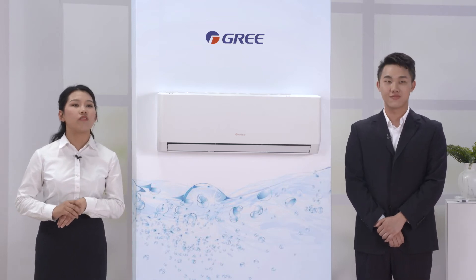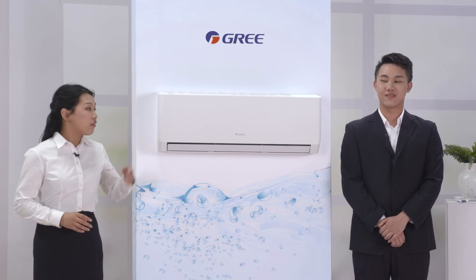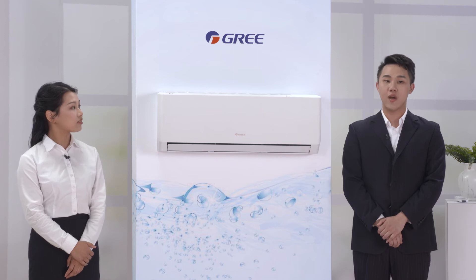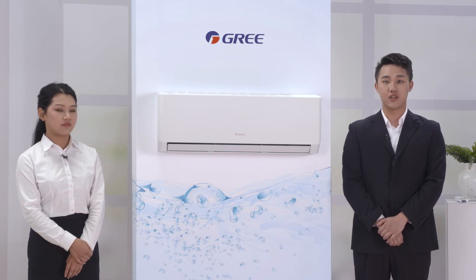Human beings not only need comfortable air, but also clean and healthy air. Since the outbreak of coronavirus, people spend more time in their homes. We think everyone should care more about individual health. PULA is the air conditioner that is made for your health. PULA has a self-cleaning evaporator which can prevent dust gathering and keep dry, bringing fresh and healthy air indoors. The evaporator cools to collect dust and moisture on the surface, then condenses them by rapid cooling. After that, the evaporator heats quickly and discharges condensate to take away the dust. At last, the evaporator reaches 50 degrees centigrade to dry the surface and prevent mold.